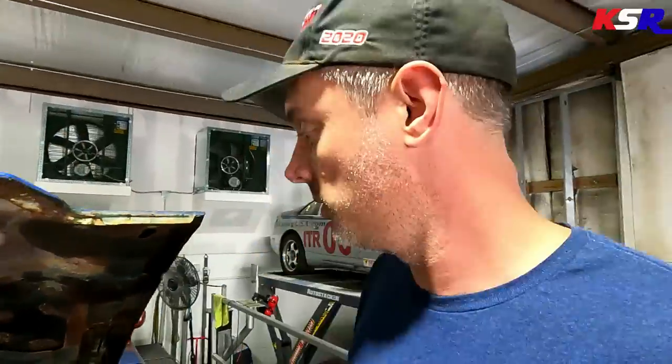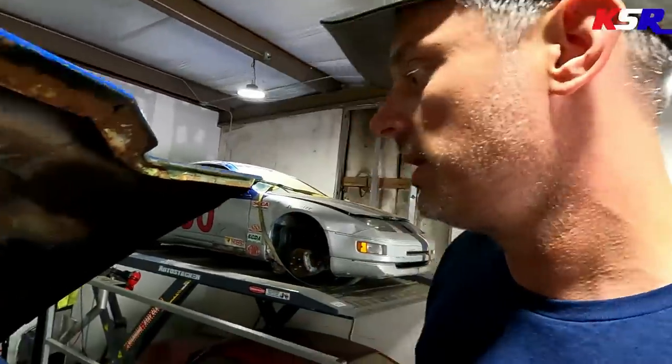And now it's time to put the blower belt on it and force some air into the motor. What do you think? Oh yeah. We can do that. We'll be back in just a minute. Well, sometimes you just don't know what's going to make a huge difference or not when you're messing with your race car. So let that be a warning to any of you guys that have one of those hats for a remote air filter on your carbureted or throttle body fuel injected setup. It's a horsepower killer, as we just found out on the dyno.